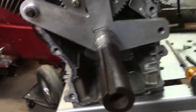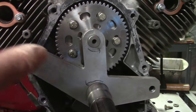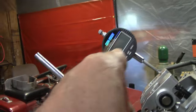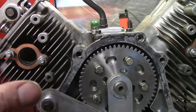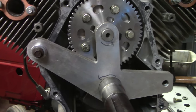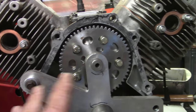Alright y'all, I got the cam tool and mount fixture all back in. It's actually been about an hour because that cam was way out. Trying to get it set to where I can loosen these bolts and rotate it to get my lift. I've got this all set up now. I've got the crank set where it's supposed to be. We're going to end the video here so I can get into a little more in depth on degreeing the cam in a dedicated video. We got it all set up and we're ready to go. I just got to pop a battery in my digital dial indicator.